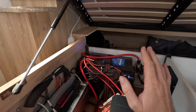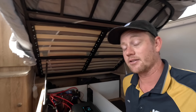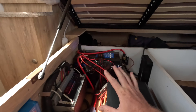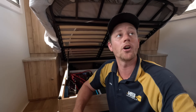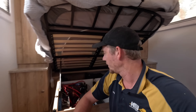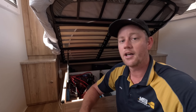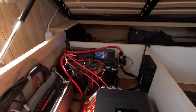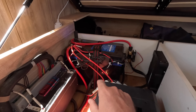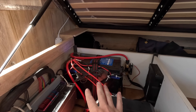The biggest expense under here is the battery. We've only got one battery but it's a big one — a 280 amp hour Scout lithium battery by Power Paul. Love it absolutely. You don't have to go that big; we went that big because it was $2,000 for 280 amp hours of hand-built lithium, which I thought was a pretty good price. Realistically you'd probably need another one to use the air conditioning for an extended period — we can get around two and a half hours of air con before the battery is close to dead. Highly recommend Power Paul's batteries.